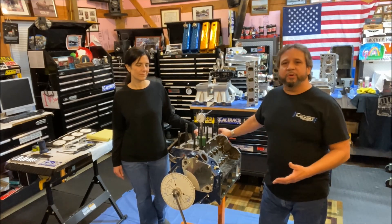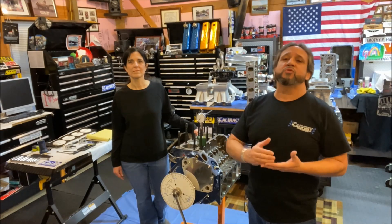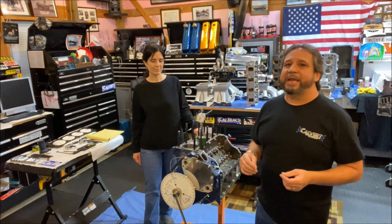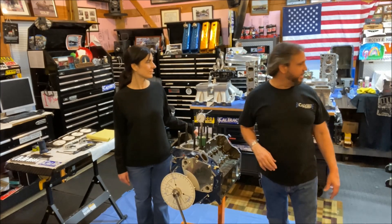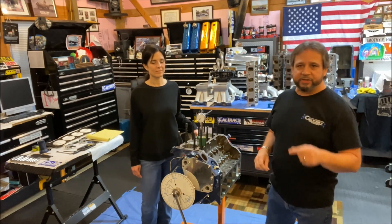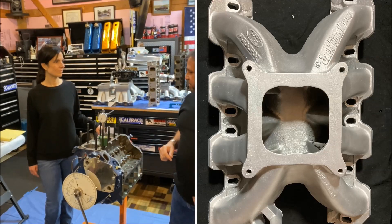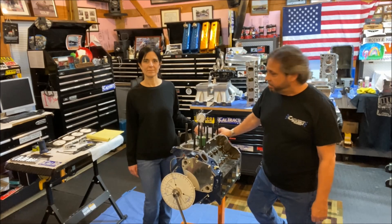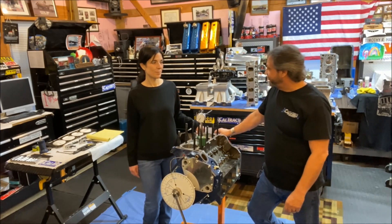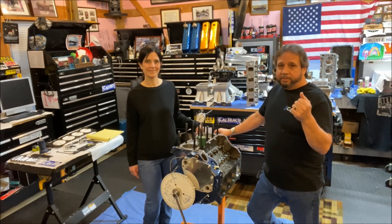You've got to do what works for you and your combination — that's what I always say, and a lot of this stuff is universal, just like the camshaft. As your cylinder heads improve in efficiency and flow, you're going to want more separation angle — looking at 111 or 112. Those engines making 800 to 900 horsepower are in the 111 to 112 range, but we're old school. I appreciate you stopping by Drag Boss Garage with Andrea Halstead — subscribe and share, and degree that camshaft in, because I hear Clevelands make power.